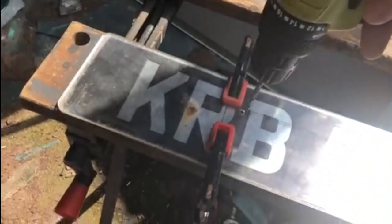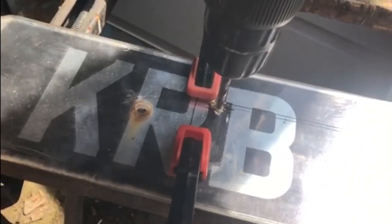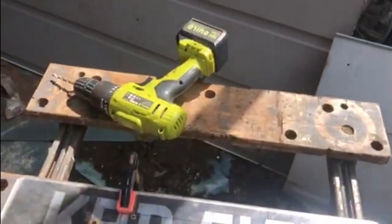The key when you start drilling is to go slowly and don't put too much pressure on it — let the drill take itself through. There we are, hopefully that's worked. As you can see, we've got a hole through there and a hole through there. Two perfect holes, no damage to the number plate itself whatsoever, and both holes are in between the letters and the numbers. Now all I've got to do is go and fit it on the car.